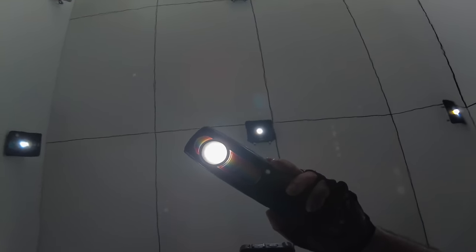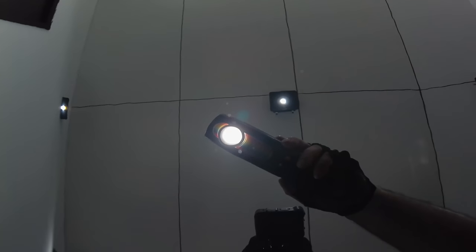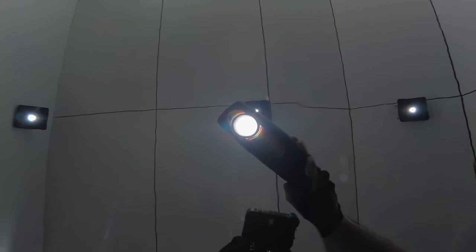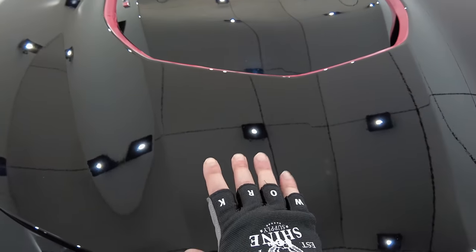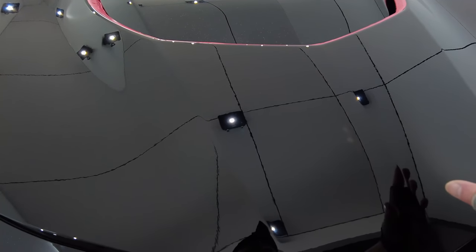So this combination definitely worked better this time round with my smaller 12mm throw DA polisher, and for all intents and purposes, it was still a pretty decent finish. But if I was being picky, I would say that I could still see a little micro hazing in the finish, meaning that it could still be better.